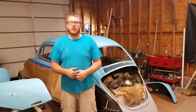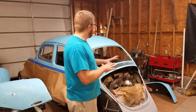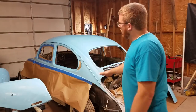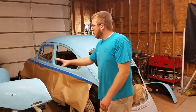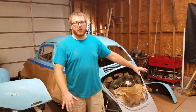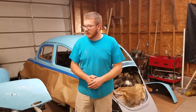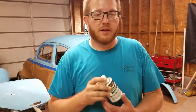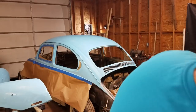I did come in one night, and I finished sanding and getting everything buffed and prepped and ready for paint. I got the sides taped up to cover up any drippage. I got pieces of cardboard and body panels everywhere throughout the shop ready to paint. I put the enamel hardener in the paint. It's now been 30 minutes as they recommend.